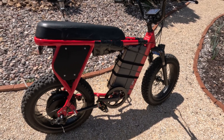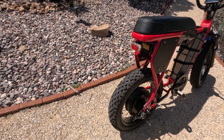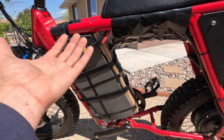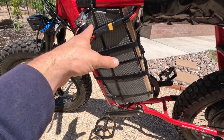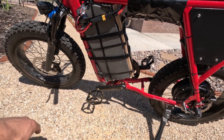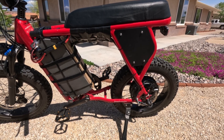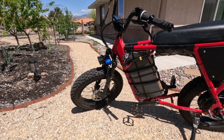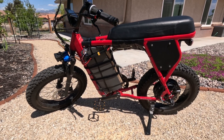So that's the build. It took quite some time to put together. I spent a lot of time getting those torque arms just right — I had to machine down a couple of parts to make them fit. There were some issues with the battery itself. I initially was going to sling it in the underbelly, but that wasn't going to work, so I had to modify the frame a little bit. It had some movement, so I even used silicone glue to secure it. Now everything's in and everything looks good — or as good as it's going to for now until I put a cover on it. My wife affectionately calls this bike Frankie, so this is going to be Frankie the e-bike from here on out. I'm going to take it on its first ride very soon and I'll bring you along for the ride. Thanks for watching, and I'll see you in the next one.